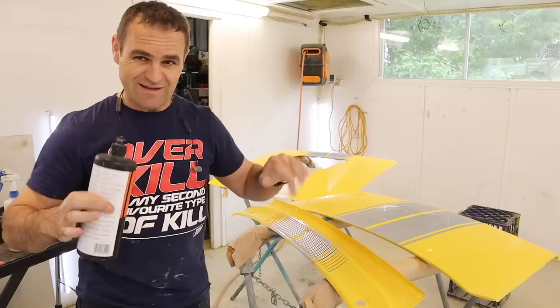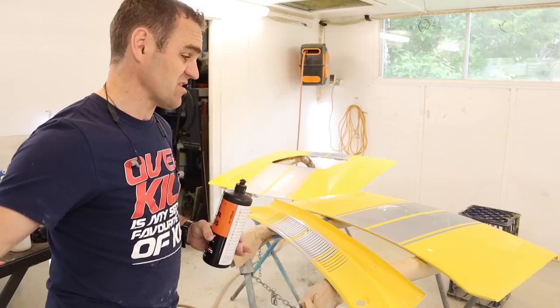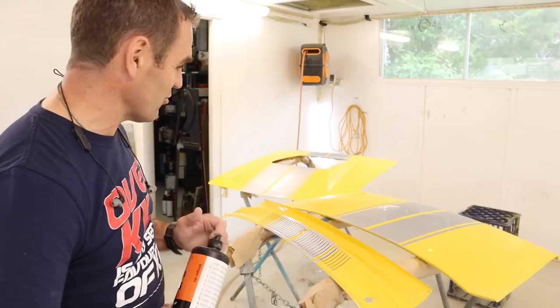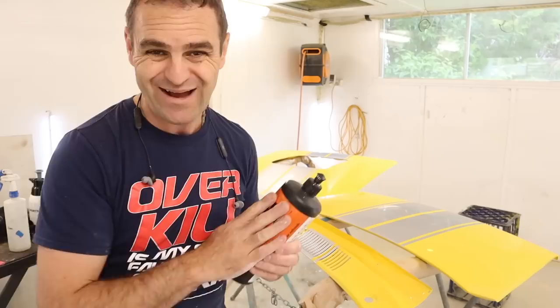Okay, so I've just gone through and sanded back the bonnet, boot and cowl, all with 1200 first, then 2000 on the DA with the soft pads like I went through last week, and then 3000. So they're all looking pretty nice, but you won't really know what they're going to look like properly until I start buffing, and there may be little scratches and stuff that I need to go back and touch up. I didn't cover last week the compound and buff, etc., that I use.